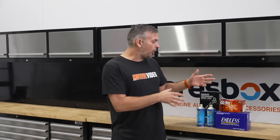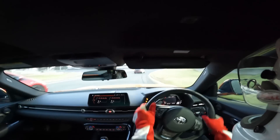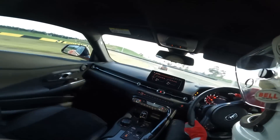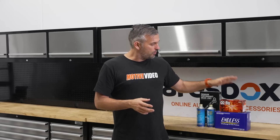This is a pretty good combo for improving the brakes on any modern car. We did pretty much exactly this on our GR Yaris before we went to Bathurst and it worked fantastic. The guys from V-Sport said this is pretty much the combo to go for with the Supra, which will enable us to have better pedal feel. The brakes will last longer before they start to get any brake fade, and we'll have overall more coefficient of friction from these pads. It's pretty cost effective compared to spending $10,000 on some giant brake upgrade kit.